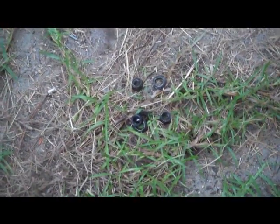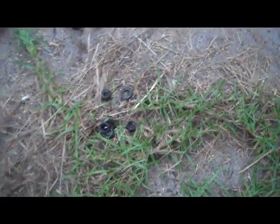Now I'm going to go after these three bolts right here, which connect my final drive to the drive shaft. Okay, so with these nuts and washers removed, this thing just rolls right on out of here. I try not to put the rotor surface down on concrete because it can scratch and scour it, but on the grass it's okay. So I'll just lean that right down in there. As you can see, I'm dribbling a little bit of gear oil onto my tire there, so I'm going to want to be sure to wipe that off. It's not going to hurt the tire, but I don't want it to be too slippery next time I take off. And I can pop this one out of here and look at it.